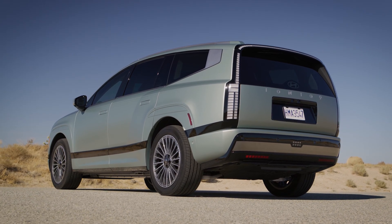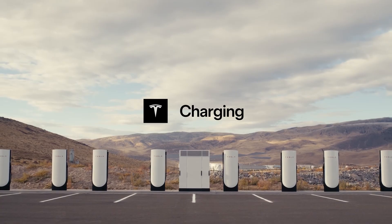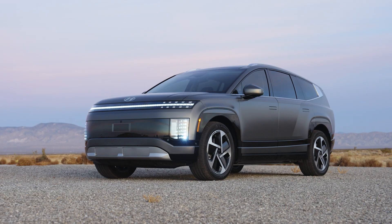While I'm waiting for this to charge, let's talk about what's good and bad about the NACS pivot. Moving to Tesla's plug standard opens up a lot more charging options for non-Tesla EV owners — about 30,000 plugs and counting. They're building it out pretty quickly, and that's going to give you a lot more options on a road trip. When you have a native NACS port like in this car, it's really going to save your butt when you run out of juice. That's the good news. The downside is that charging speeds on some non-Tesla EVs may be a little different. Take this Ioniq 9: normally its max speed is around 237 kilowatts, making it a really fast-charging EV. Hyundai says it'll go from 10% to 80% on a fast charger in just 24 minutes — a lot shorter than the 35 minutes I've been quoted here. So why the difference? The answer is voltage.